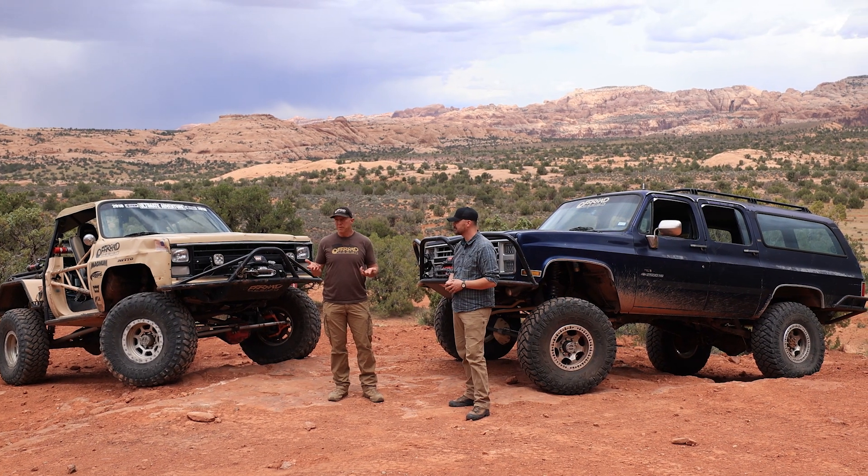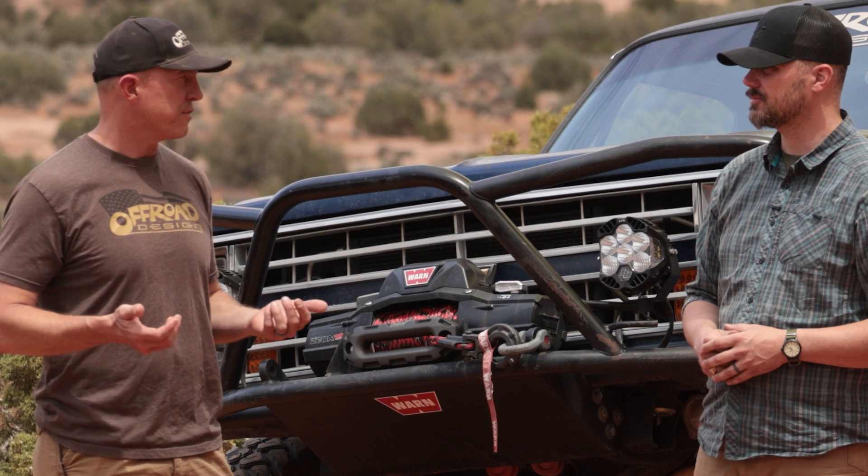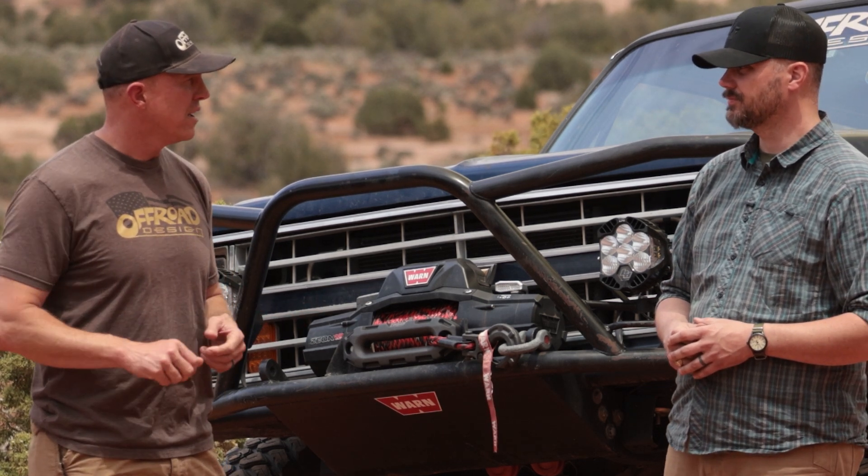If it's more of a street cruiser truck, not a super demanding use, maybe that rear suspension you had before will continue to be fine for you. When you start pushing the truck a little further and asking for more, the off-the-shelf lift kit type spring setups — about the only one worth considering is the 64-inch leaves out of the 88-to-98 trucks, because those are typically long enough that you can get some reasonable wheel travel out of them. It's not great, but for something you can pick up off the shelf and run in easy approximations of factory bracketry, that's a solid bottom-end starting point.